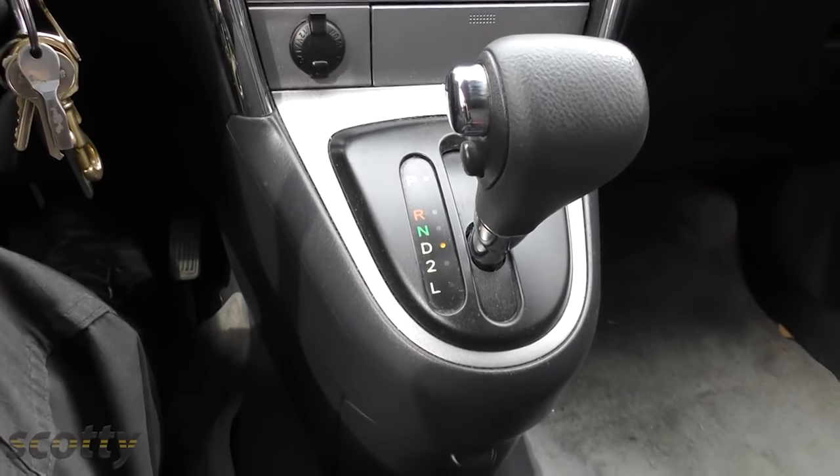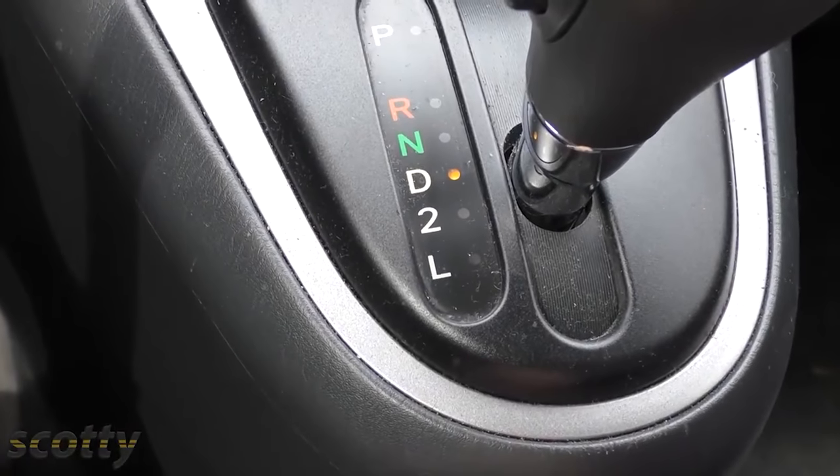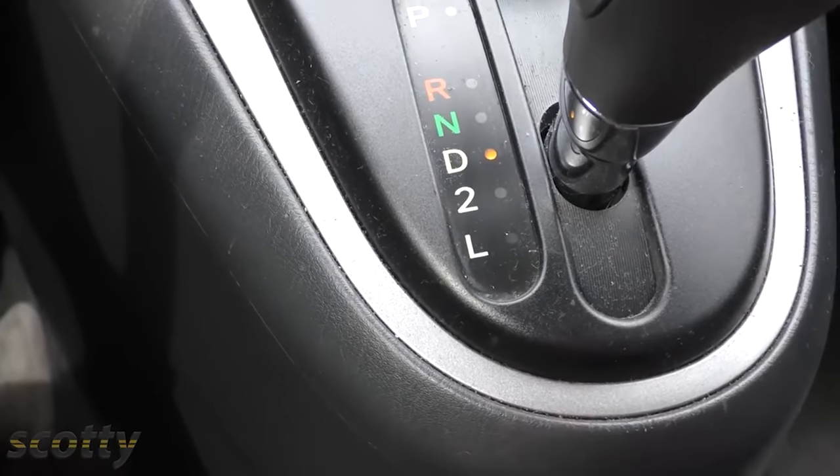Don't leave the car in drive if you're going to idle for a really long period of time, because leaving it in drive while idling for a long time can lead to overheating inside the transmission. If you're going to sit there for a really long time, shut the car off, or at least put it in Park. In Park it's not directly connected - the torque converter isn't sending much power - so it won't get quite as hot as it will sitting in drive.